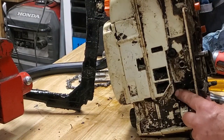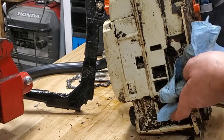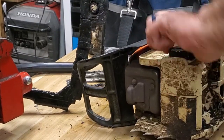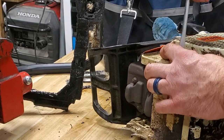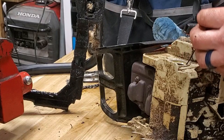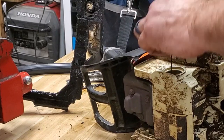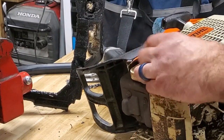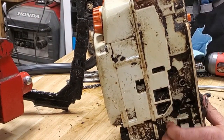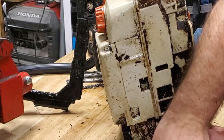That oil hose I was just talking about is right here. Let's go ahead and make sure all the oil is emptied out of this thing. It's been leaking — I'd be surprised if there's any in it. Nope, it's pretty much bone dry. I'm going to put that on to keep the dirt out while I clean this up. To pull out the oil hose — which are normal wear items — just pop this grommet out.